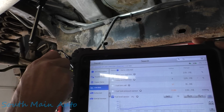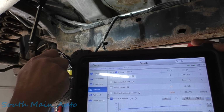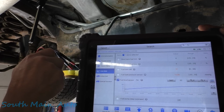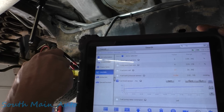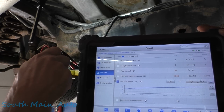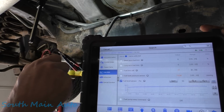So this is a good wire integrity check. It's the only way I know how to do it. Or you could actually use the fuel level sensor itself. Pick up a little bit there, Phil. Good man. And then you can see we're coming up. As resistance keeps going up here, I think we've passed 250. But once it nears, oh, we got some dinging going on up there.